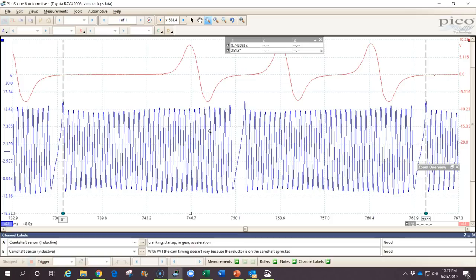There's one more condition this waveform helps identify: if the timing between crankshaft and camshaft is incorrect, this waveform will tell us with a lot of accuracy. Otherwise, to check timing you'd have to remove the timing cover and inspect marks on timing chain or belt sprockets, which can take a lot of time on some engines. This waveform method is much faster — just measure and compare to a known good waveform.